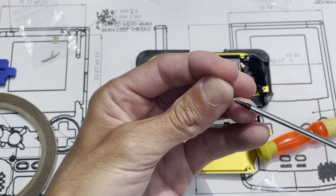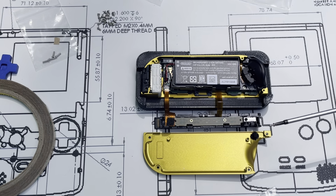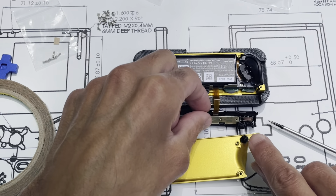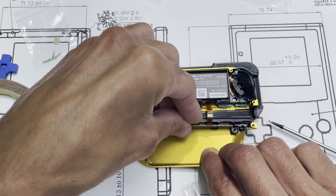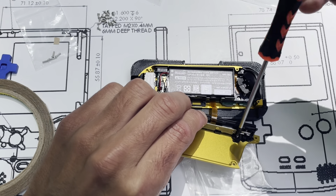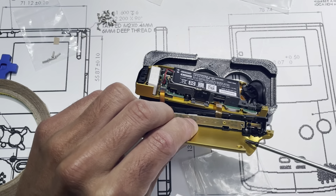What I do here is I'll usually get a 3 millimeter screw. Sometimes there are instances where a 3 millimeter may not work. It may bottom out. That's when you'd switch to a 2 millimeter before forcing it in. So we got our 3 millimeter ready. It's on our screwdriver. Button's in. Once again, in position. Put this over. The one fastener into the hole. That hole. Can you see? So what I'm looking out for is, is it going down? Is it going in? Is there a gap? Everything's good.